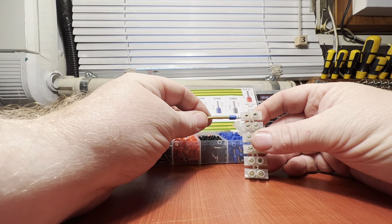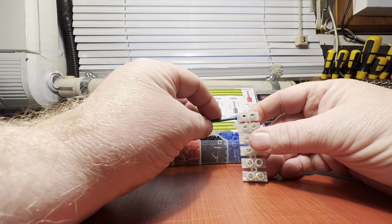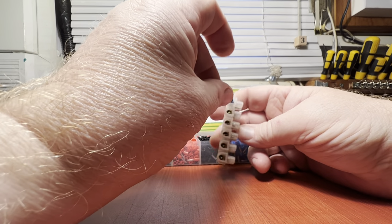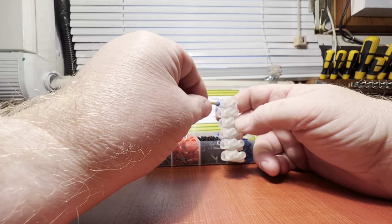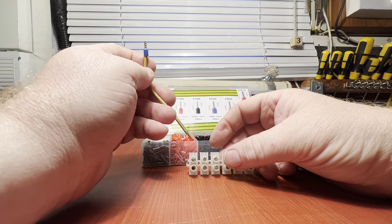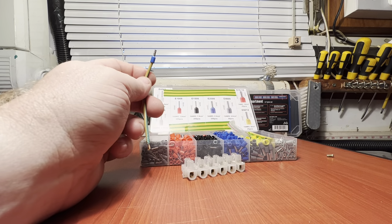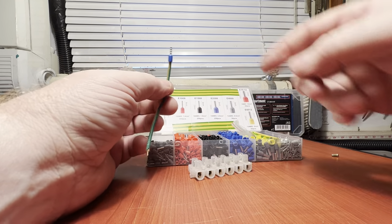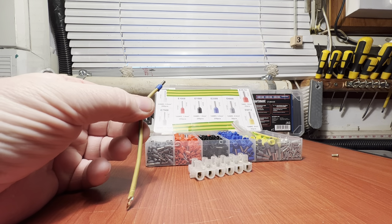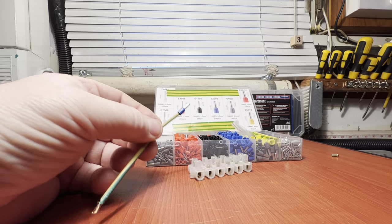You can actually shove that right in. Right, and that'll tighten in there. And it's quite sealed, eh? Quite sealed. Or you see the sparkies using them when they're rewiring your house, the big main board in the house with the circuit breakers and all that, they put ferrules on it, and it's a tidy job. It's a far tidier job, guys. And that's basically it. Aye, so that's how ferrules work.